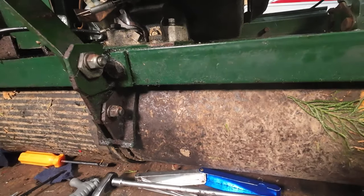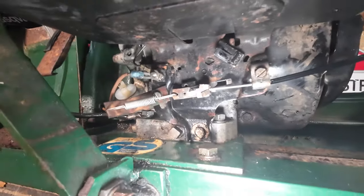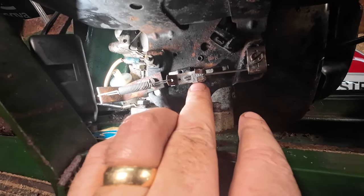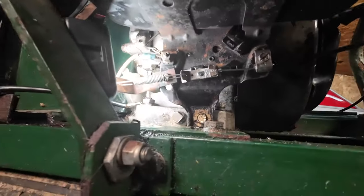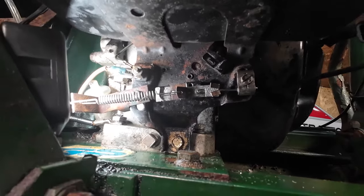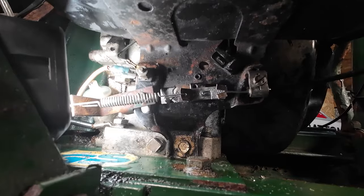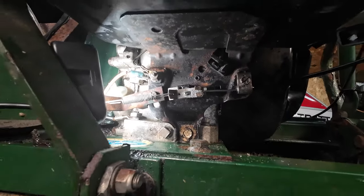So I think we're making a bit of progress now. I've had to remove the old cable and I've put a new cable in, only because the old cable just wasn't giving me enough throw on here. So what I've done is put a new cable in, crimped the end off, because it wasn't actually cutting off on the micro switch. But now I've threaded the new cable on. You can see I've got to stop — that would be idle, flat out — and it returns now back to where it should be. You've now got a full range of throttle on there, whereas beforehand you had next to nothing.